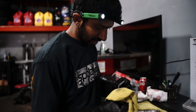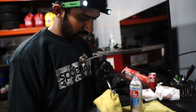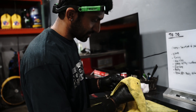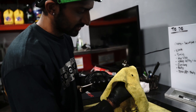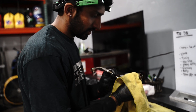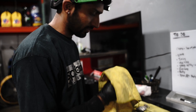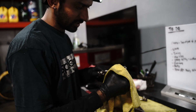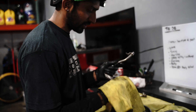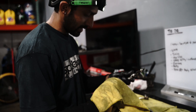I like to clean up all the lines with chemicals — we're gonna spend all this time removing the turbos, so we want to make sure we can spot any leaks. More importantly, we want the customer to actually enjoy his turbos, and it allows us to warranty and keep an eye on our work. If there are any connection points leaking or issues that arise down the road, we can stay ahead of that. Right now I'm wiping them all down to get any residual oils off, then we'll clean the insides with brake cleaner so they're super clean inside and out.